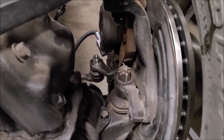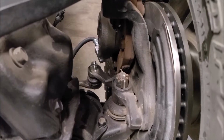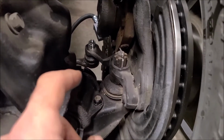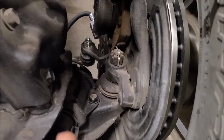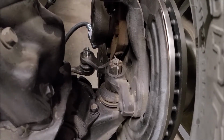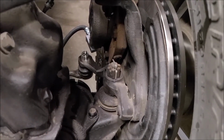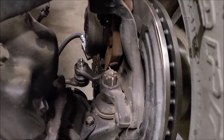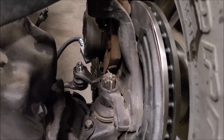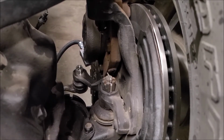Maybe the washers I've got aren't very soft or something, and they're not conforming to the surface. Or I'm starting to wonder if on the line side they've actually embossed some sealing surface, some rings around it, so there's a place for the washer to bite in, and the calipers didn't have that from the get-go. The surface was terrible, but it wasn't done like that. And filing it makes the surface real smooth. I could see that maybe having an issue sealing, not having any deformities in it, or embossed, or whatever you want to call that.